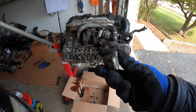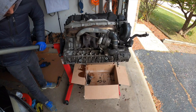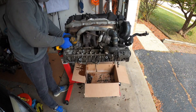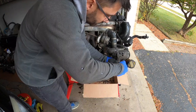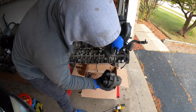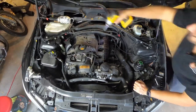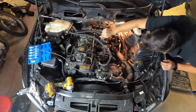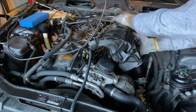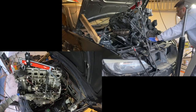Check out my video where I disassemble a BMW N55 engine and take the cylinder head off to get an idea of what it would take to get to this point. If those specifics aren't really your thing, I'm highlighting the basic steps in this video. Step 1: remove the engine from the car by removing the exhaust system, draining all of the fluids, removing the intake, radiator, all of the piping, and disconnecting it from the wire loom and transmission. That was easy — the engine's out now.